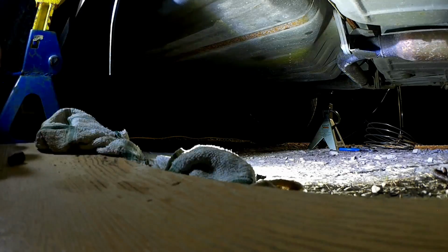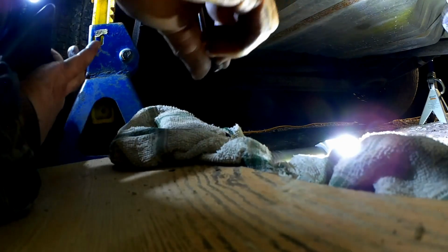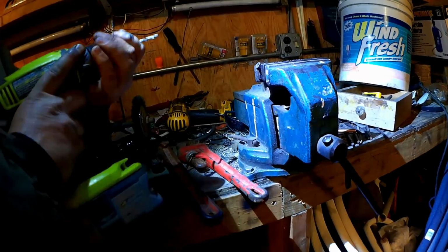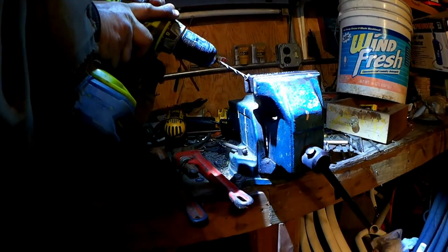Good show. Now, before I start trying to do this crazy bend up here to join with the rubber line, which for some reason is facing away from the source of the steel line, whatever. Before all that crazy bending, let's go ahead and get that nut on there. I'll shove it way up out of the way. Well, that really didn't want to go on there, so I'm going to take cleaning to another level with my 3/16 drill.